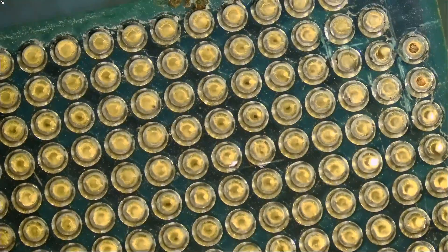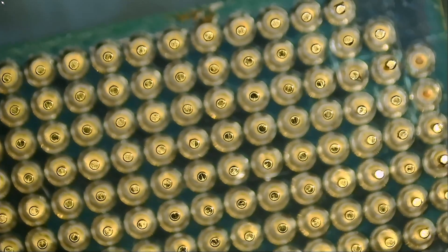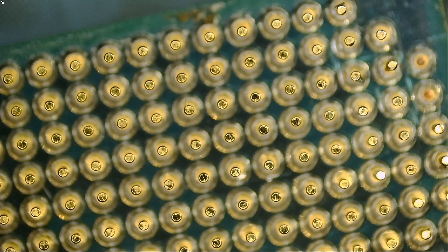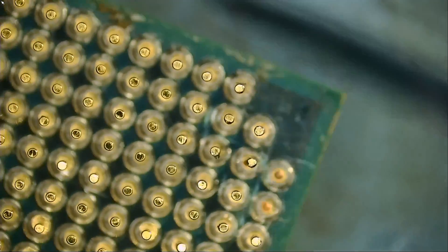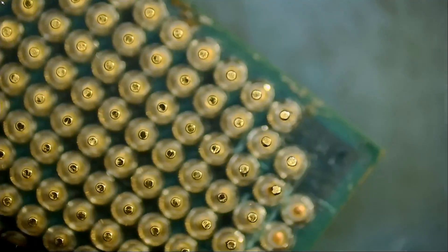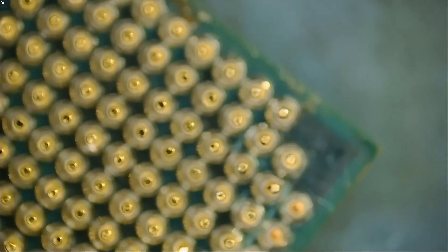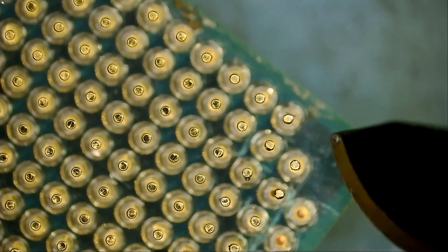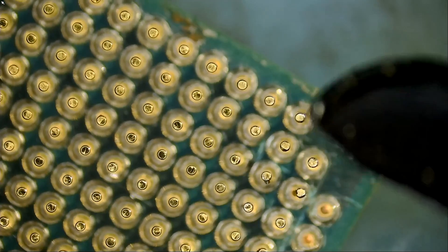If we lay the CPU flat down, I'm going to focus on the very tip of the pins. We can tell based on the way light shines on those pins if we have a bent pin or not. We're not focused on the base of the CPU, but on the very tip of the pins. So the bottom will look out of focus, but the very top of the pin will be in focus.